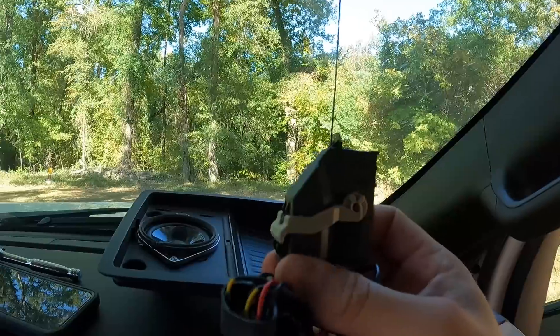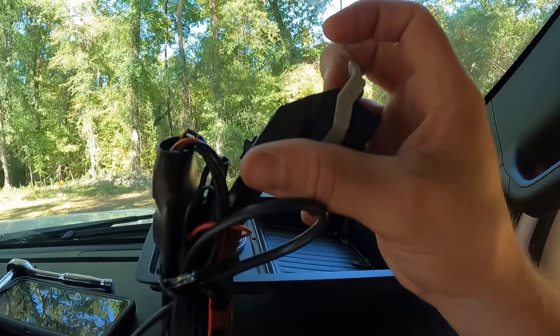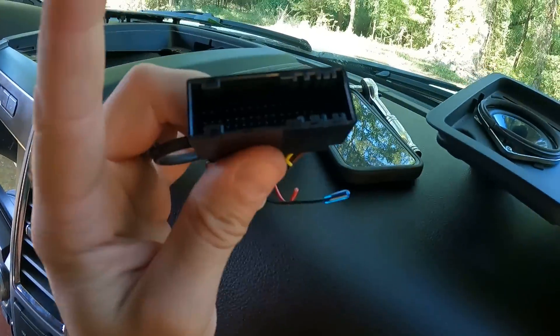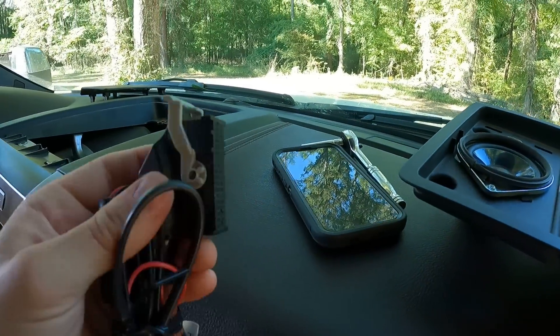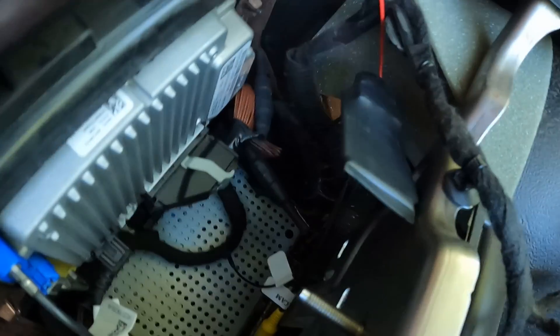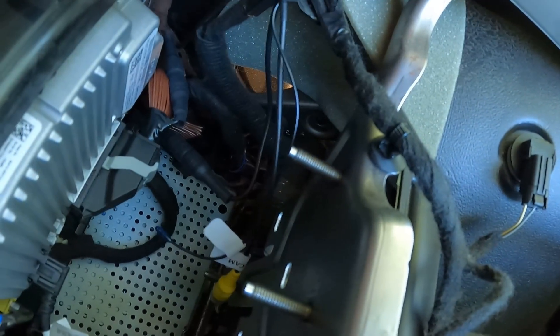It's better to have one of these plastic levers because using a screwdriver could put scratches all in your plastic. Now we have the speaker connector we need to take off - easy squeezy lemon peasy. Once I got this top part off, I have access to what I'm replacing on the back. You lift this lever up, push down on this little tab, and swing that back. That's going to plug in here, and then this part will plug back into the back of the radio. We're adding more components - a little switch, a yellow wire, and the receiver.